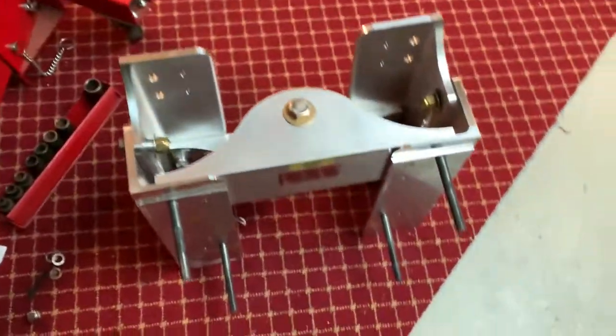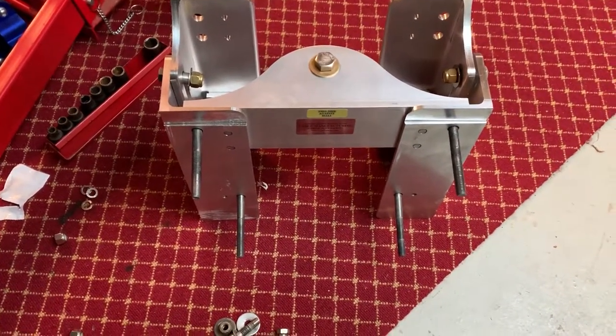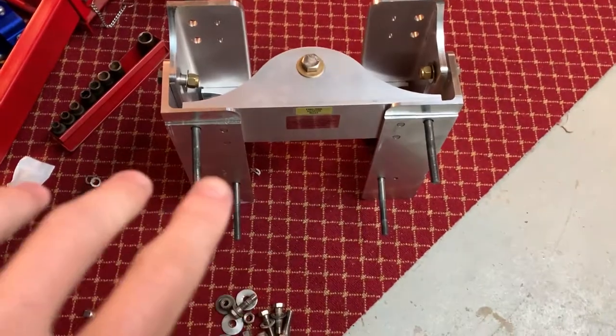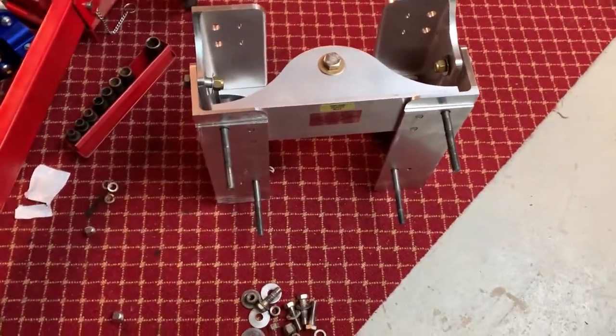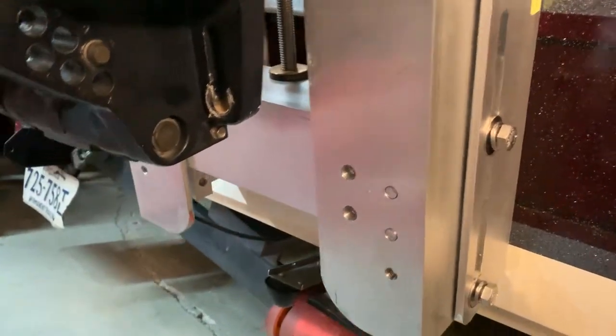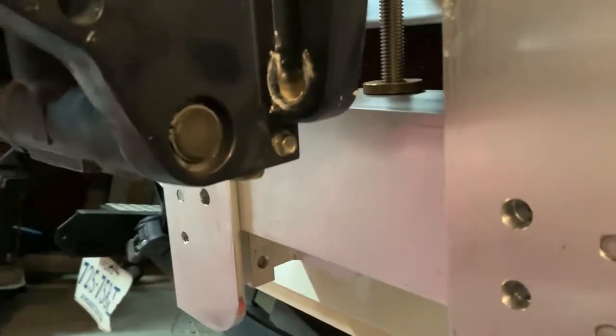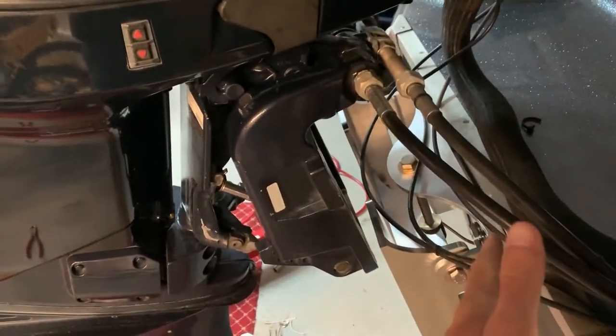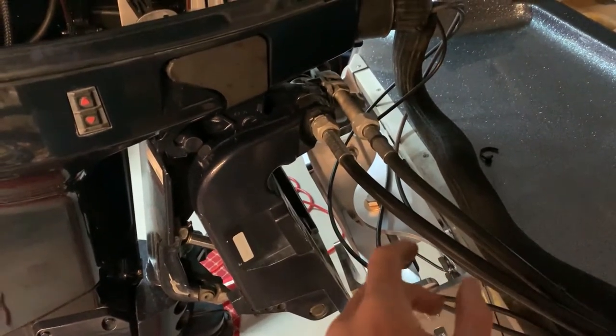As you can see right here, we have already put in the bolts so that all we have to do is hoist it into position and slide the bolts in — we don't have to hold it there while somebody frantically grabs the bolts. We just got all the bolts through the transom. The bottom bolts are down there and the top ones are up there. Just got them snugged on so everything's staying in place and that jack plate isn't falling back anymore. The adhesive, even if it starts to dry up a little bit, it's not going to be the end of the world, and we're going to finish by tightening them up.